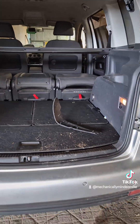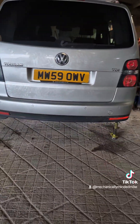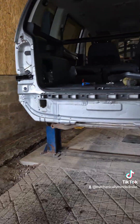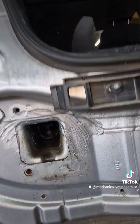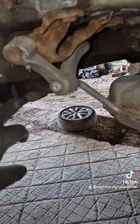So this is what she looks like currently. Back bumper's off. Take the crash bar out as well — when you get the bumper out, there are bolts under here through the bumper — one there, another one there, there, and there. They're T27s. Clean up with a wire brush; you can get to them from the inside. A bit of oil, because otherwise they're going to snap.